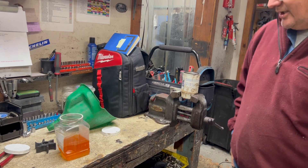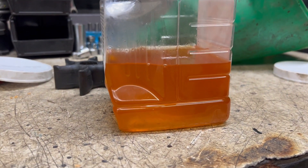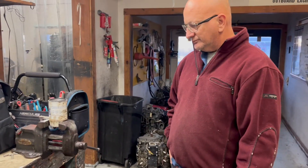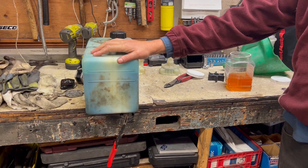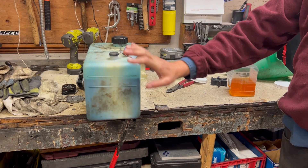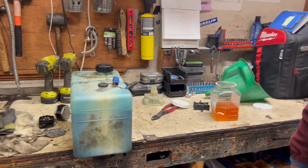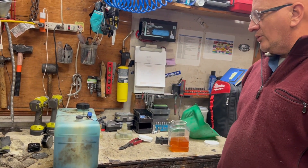That's a pretty funky color — there's a lot of stabilizer in it, which is okay, but we're probably going to tell the customer it might be a good idea to drain the tank. We also removed the oil tank for the oil injection for this two-stroke outboard. Water gets into these much more rarely than it gets into the fuel tank, but when water gets into an oil tank it destroys the motor immediately.